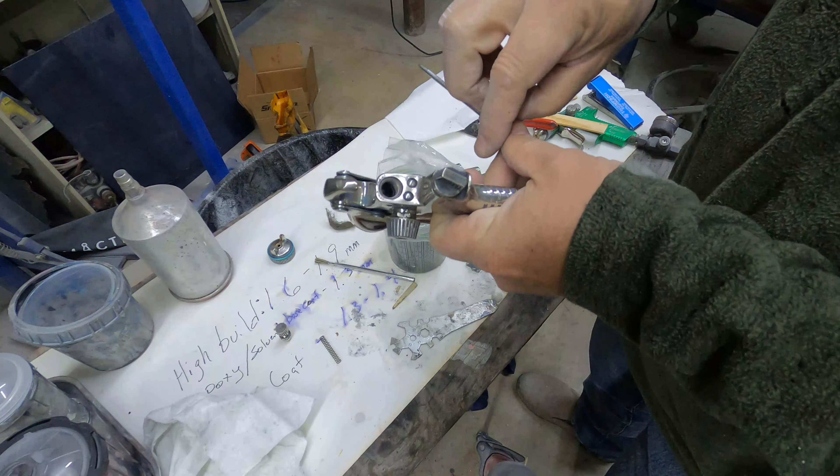She's not gonna spray any more material than that. On this gun I believe it's 24 or 27 pounds coming in — you get 10 PSI at the cap, which atomizes the paint good. With the trigger pulled all the way back and the fan wide open, that's a good setting to start playing with the gun. Next episode we'll talk about setting the fan, defects that we can have, and what it looks like when things are working right.